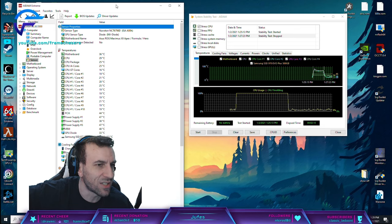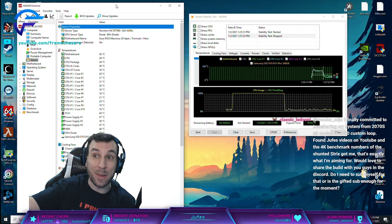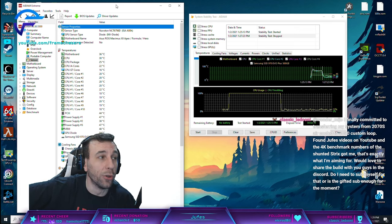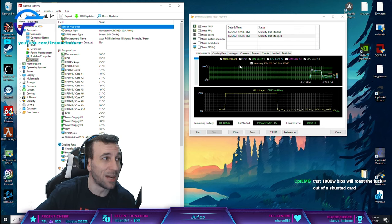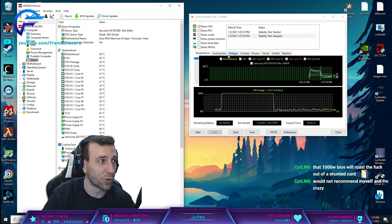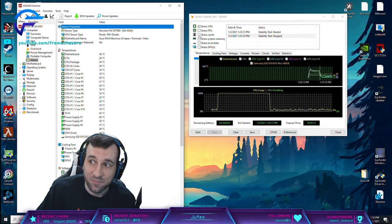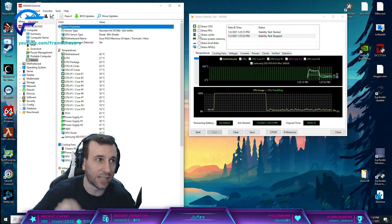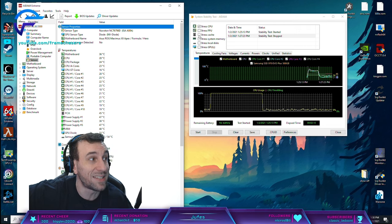The issue with the TEC is loss of effectiveness as it gets hot. I was playing Cyberpunk in the living room and after I finished, I came back to my PC and this whole area was just sweating and muggy. It adds a surprising amount of heat to the loop. My Strix was pumping like 700 watts into my loop from Cyberpunk, then the TEC was pumping another 200 watts, plus another 200 watts from my CPU - my system was pulling like 1100 watts. That's a lot of heat for radiators. I might need to redo my radiator setup, maybe get a thicker 120mm to make up for the TEC.